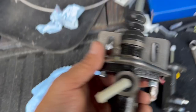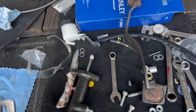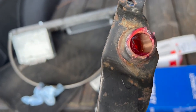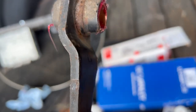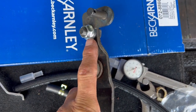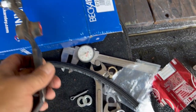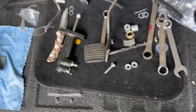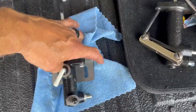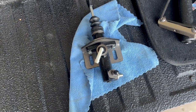I'm working on getting the master cylinder ready to put in the truck — bolted it on with the two little allen head bolts that came with it. I took the clutch pedal and put a brass water nipple in there to make a bushing out of. To adapt their adapter, you have to drill the hole out to fit the little adapter they made if it doesn't already have the right size hole. Got that done and I'm fixing to start trying to go back in with the pedal — it's tight quarters in there.